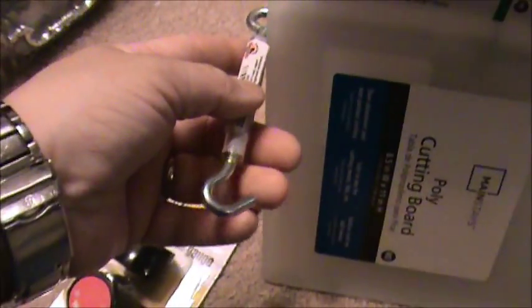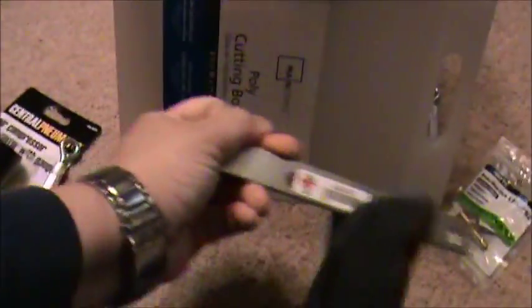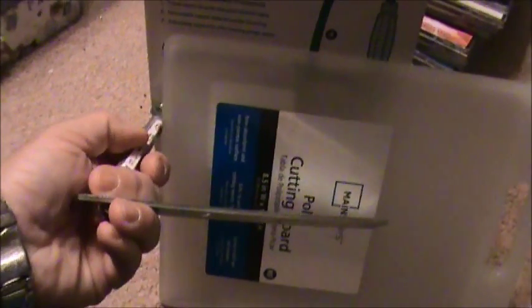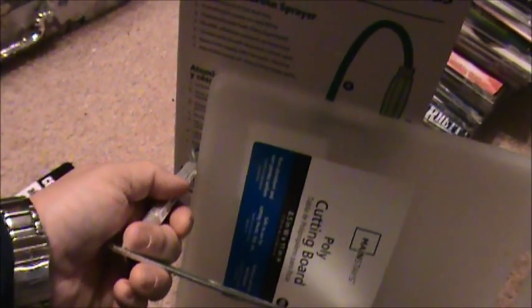The way this is going to work — I'm not going to build all this tonight, but I'm going to cut this piece out. These are turnbuckles, and they'll go through the board. This strap will be down toward the bottom of the actual master cylinder body. You hook it, the strap goes under the master cylinder, through the board, then you snug the turnbuckles down to tighten it against the top of the master cylinder — it just clamps on pretty as please. I'll drill the holes toward the center of where the two reservoirs are.